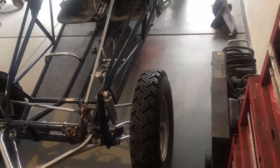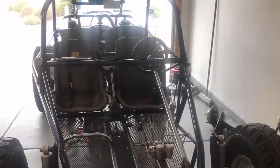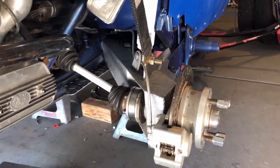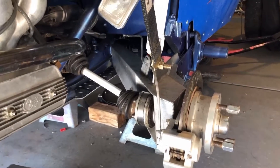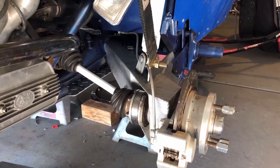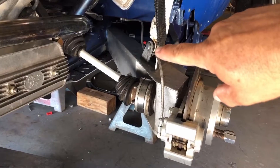I was measuring and getting an idea of what I wanted to do first, and I decided to change the trailing arms to a heavier-duty, longer set. So I removed the stock trailing arm and built this with the shock mounts added here.